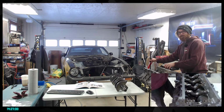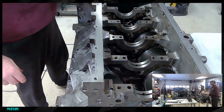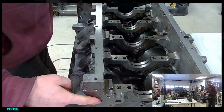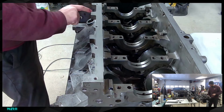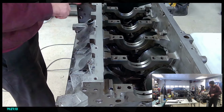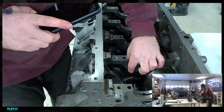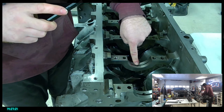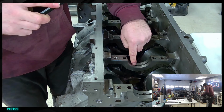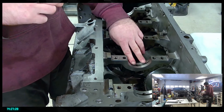So when looking at this here, dual side. Let's make it bigger. So it's moving from the front here. You see the plug right there. So this is a cylinder moving all the way from front to back of the engine. And then it's moving through those metal here. That metal here has oil gallery coming right in here. And you see how this is done? This is allowing the oil to cover the bearing surface at the back.